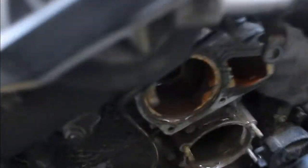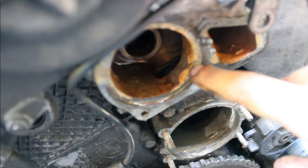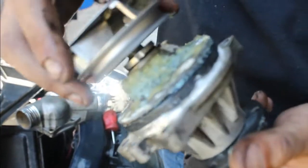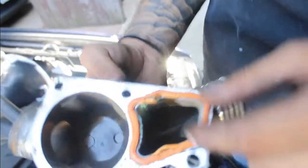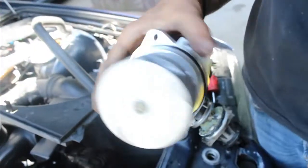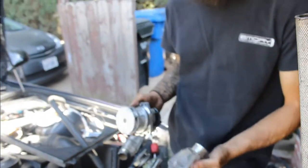Now we have everything removed. As you can see, that lower hole is where the water pump used to be, and the top two holes are where the thermostat housing and thermostat used to be. We actually didn't know how bad these were when we decided to change all these — we just did it preventatively. But as you can see, it's a really good thing we did. These gaskets are just going to shit. Any time we pushed the car hard on the track, those things would have gave out super fast. This one is just ready to come apart at the seams. Something that's not too expensive to do but something that's really going to help you out in the future. It looks so much cleaner. Trust me, you don't want this breaking at the track — you want to fix this in the comfort of your own home.